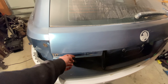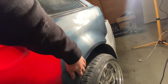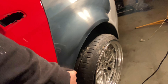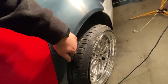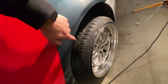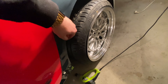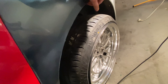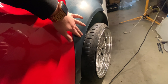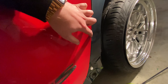The bumper is literally just clipped in. We still only have this guard that's rolled, so I need to come through and chip off every little bit of paint that's going to want to come off — because if it's sitting underneath the base coat when we paint over it, we've got a weak base and it'll just chip and flake off anyway. Get it all off now, and when we do the wet-on-wet primer it's all going to stick. Tonight we'll be addressing this dent here and this one here.